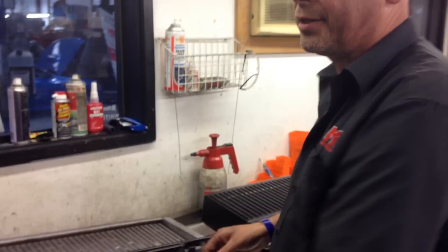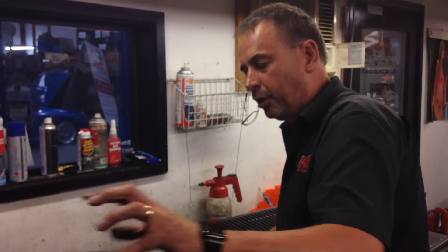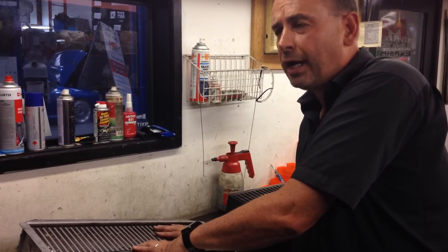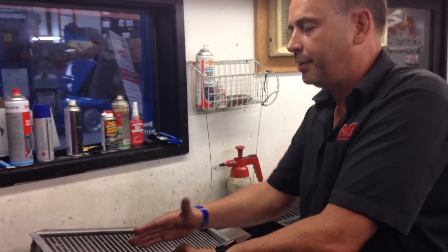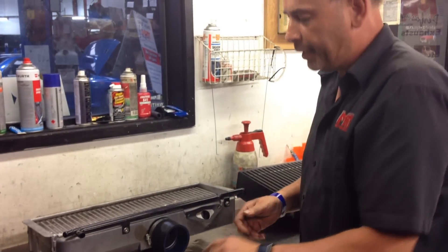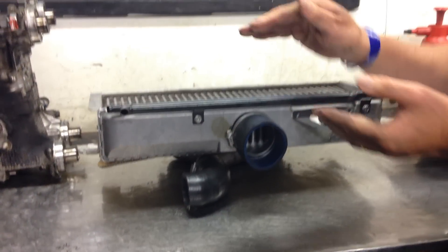The reason for that is if it was stepped — like some aftermarket intercoolers have — you always get a little bit of blow-by, because you've got the crankcase ventilation system going into the intake through the turbo. You always get a little blow-by through the intercooler, and the intercooler almost acts as a semi oil separator before it goes into the engine. A little bit of oil gets collected out of the compressed air, pooling in the intercooler, and as you go around corners it might pool in one end or the other. If you didn't have that flat part parallel to the bottom of the intercooler and instead had a step, that step artificially creates almost a bath that collects even more oil before the engine gulps it through.